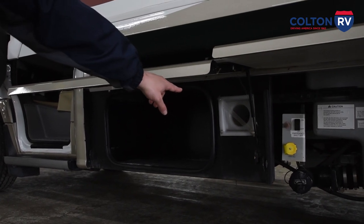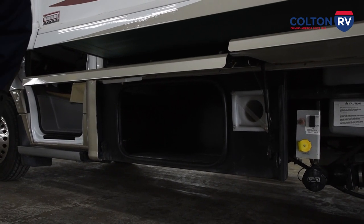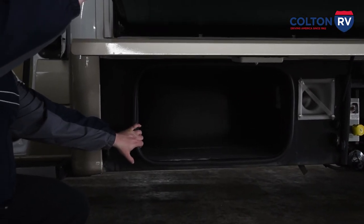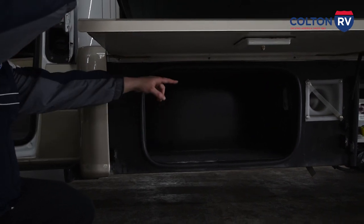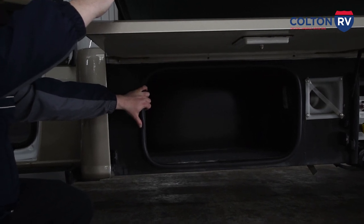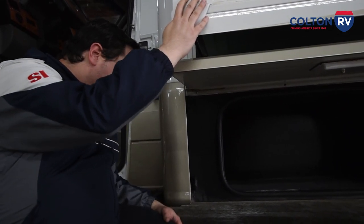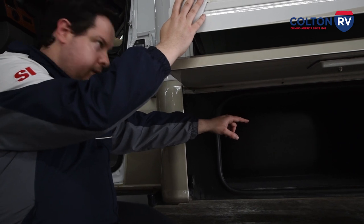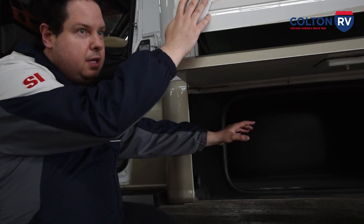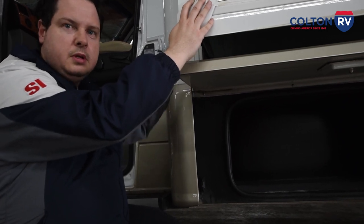Just to the left of your emergency shutoff, you've got this container right here — that tube right there will store your sewage hose. There's a little strap on that so it won't slide around. In another storage compartment, there is one module worth knowing about. On this wall is a little computer that controls the slide room above it. If this ever freezes up on you, the instructions are right on the little panel on the side wall — there's a little white box with a hole and an arrow. If the slide room gets stuck, you push the button in there six times and hold down on the seventh. That resets the slide system and will let you pull it in.